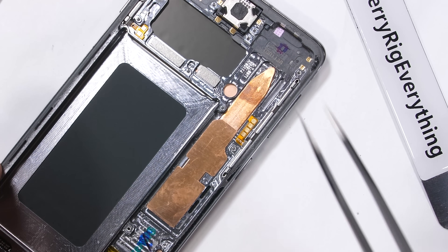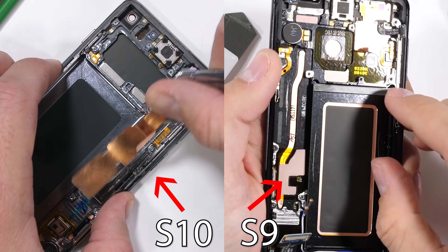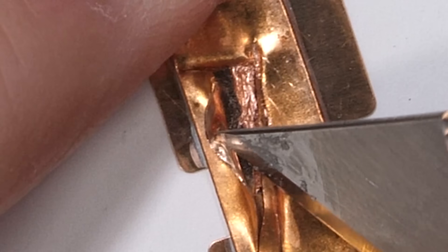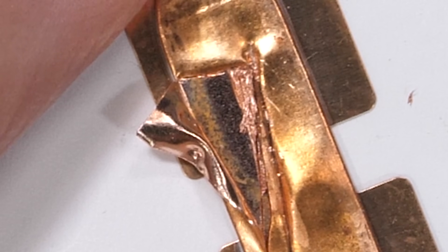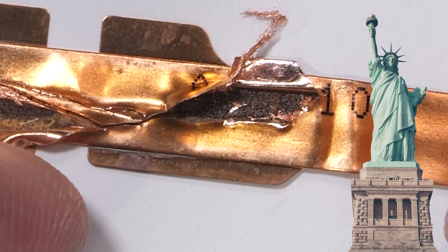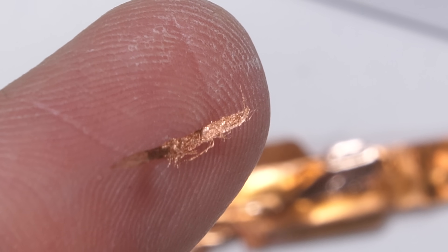Let's get a closer look at that heat pipe. There is a water damage indicator next to the SIM card tray opening. The copper pipe on the S10 is massive compared to the heat pipe on last year's S9 — it's crazy how much copper Samsung has added this time around. It's still not quite as big as the Razer Phone 2's copper waterbed, but you can see the liquid inside. It evaporates as soon as I slice it open with my razor blade. It also looks incredibly dirty inside — copper doesn't rust, it turns green when it oxidizes, not brown. That's the same reason why the copper Statue of Liberty is green. The mud inside this copper pipe is something else. Every heat pipe I've opened up has been clean. There are copper strands inside though — these help the liquid wick from one end of the pipe to the other to transfer heat.